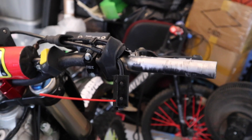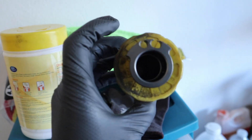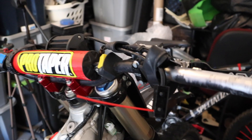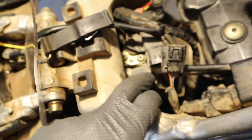So you can see I'm in the middle of getting my throttle situation back buttery. I got the throttle tube all cleaned up, but I realized that wasn't really the issue. I don't know when the last time that throttle cable's been lubed and I haven't lubed it since I got it. I didn't exactly know how this throttle situation worked, so I took the tank off and everything. I didn't want the lube to get inside the actual throttle housing and go to the motor. But as I took it apart, I did realize it's not really connected to the motor part. So I didn't have to take all that out, but you learn as you go.